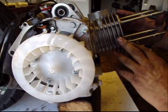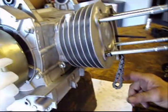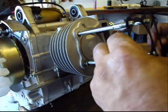Now that I have my cylinder on, I'm going to make sure my timing marks are lined up. With this trigger right here and this dot right here, you line these two up and that should be top dead center. Now I am going to install my new head gasket — just slide it over like this.